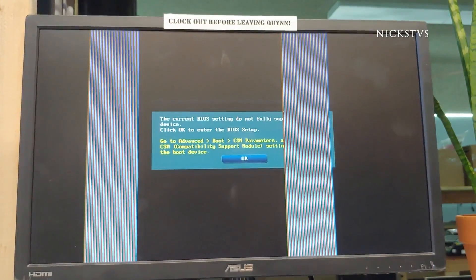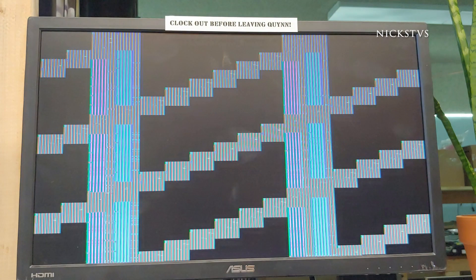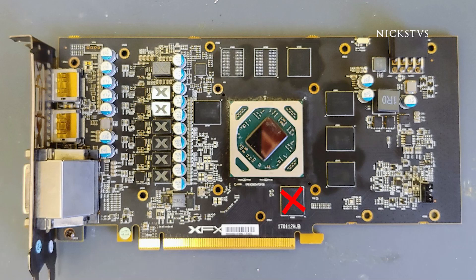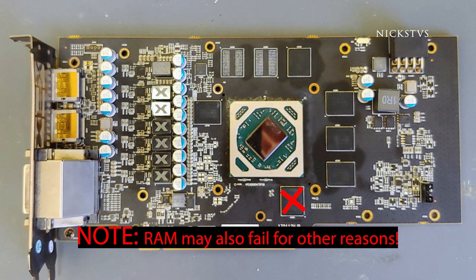As you can tell, there's a distortion on the screen that's checkered, and sometimes you might experience lines or random blackouts, dropouts. That's caused by this issue here — the RAM brick. What happens is that traces end up getting ripped, more than likely from pressure on the PCI Express slot, and just the card sagging, and that'll cause this issue.